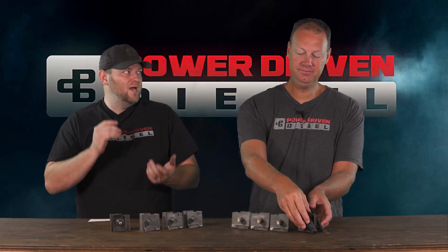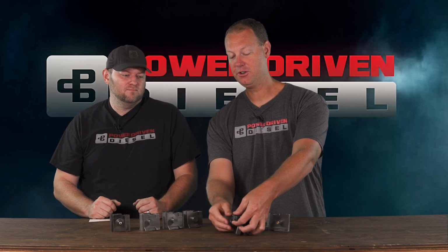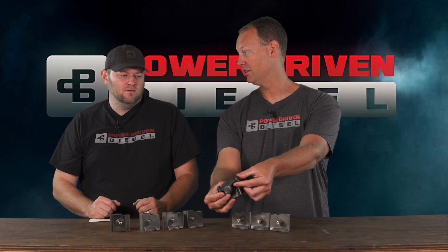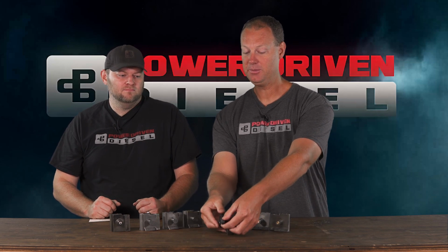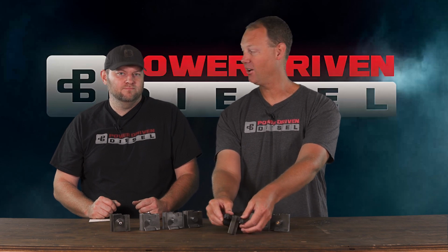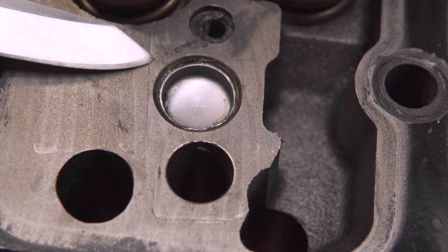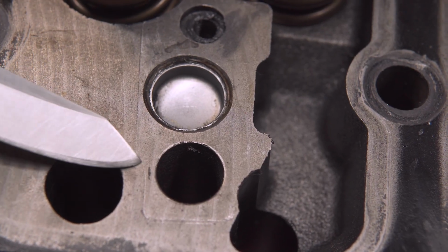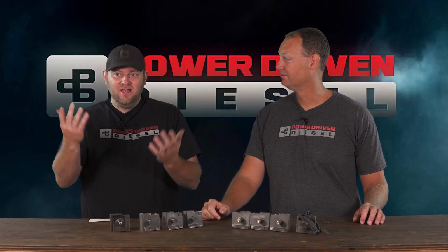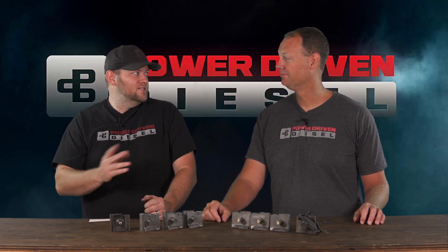When you get a bigger cam or higher RPM, here's why that happens: you have your pushrod right here pushing up, and you have a spring resisting it. As this pushes up against the spring, it actually rocks this way and back and forth, and they just wag like crazy. In fact, we got footage of it on one of my heads. It actually has creases on the head that you can feel from the rocker pedestals. This is for my junker drag truck. It might have 10,000 miles on that head, and it's loosened so much.